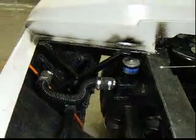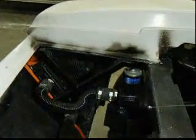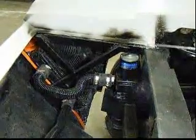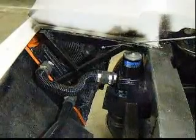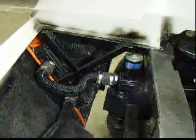At the rear of the car we have two four-core radiators mounted directly to the fiberglass body. I fiberglassed in with dura glass the mounting points so that it's not mounted to the chassis — it's actually mounted to the body so that we get a lot of good air flow going out the rear of the car. The fans that are positioned right here push the air out through the back of the car once the temperature of the water reaches a certain point.